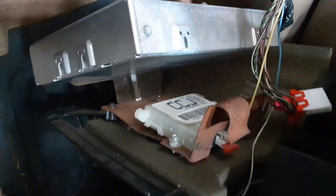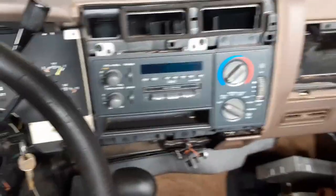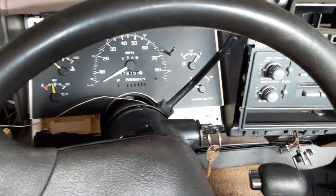Now I'm going to redo this wiring, clean it up, make sure I don't catch anything on fire, and put the whole dash back together - because you had to pull the whole dash apart to get to that connector back here. But now you know: if you've got a '94 or similar with that box, blue wire with a black stripe, you're all set.